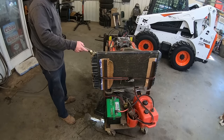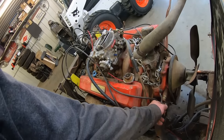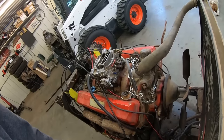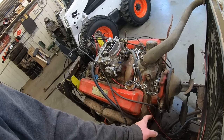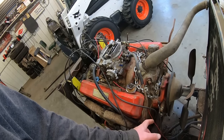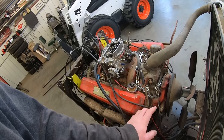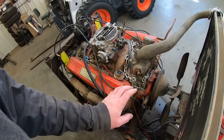Oh man, we got our first leak. We gotta plug off the heater hoses. That was a large oversight on my part. So, one's 5/8, one's 3/4. So we just put a 3/4 hose on there and loop it. I mean, the right thing to do would be to pull those out and put pipe plugs in there, but fittings, like everything else, cost money. Rubber hoses are cheaper.